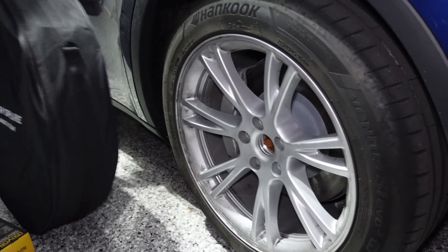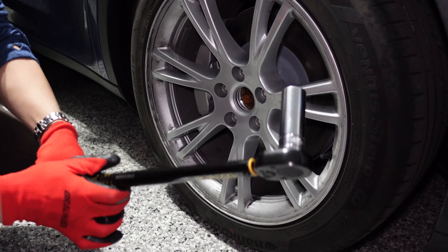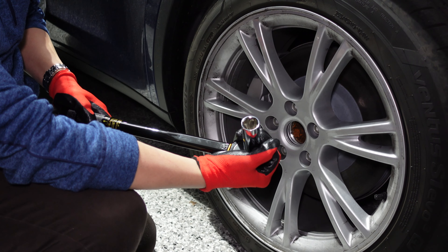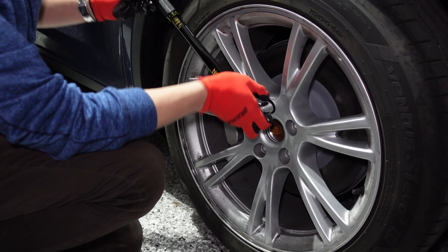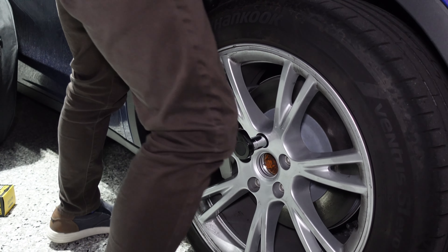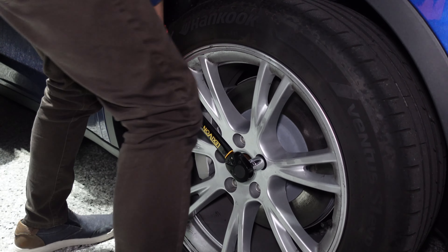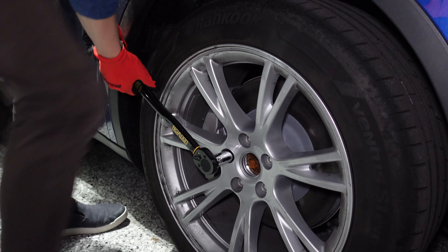It's also got a ratchet — left and right — so we'll go right to tension the nuts. Let's pull off the wheel cap. I've got aftermarket caps from EVBase, but if you don't have those you might have the generic OEM Gemini caps from Tesla. Either way you need to pull it off if you've got a rear-wheel-drive car with the 19-inch wheels. Just put your hands in the spokes and it pulls off — they're basically just clips on the back.